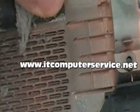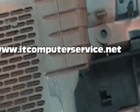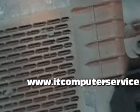Notice how much dust accumulated here. That's probably what caused the video chip to fail — it got really hot, overheated, and then just failed. So you take this off, clean it out, and then it should have enough air coming in. Peel the film off and you should be okay.